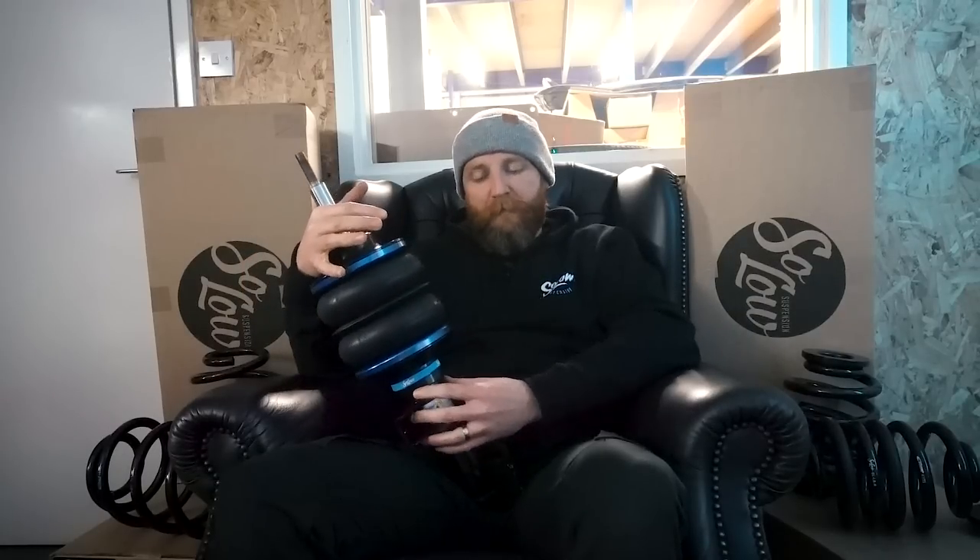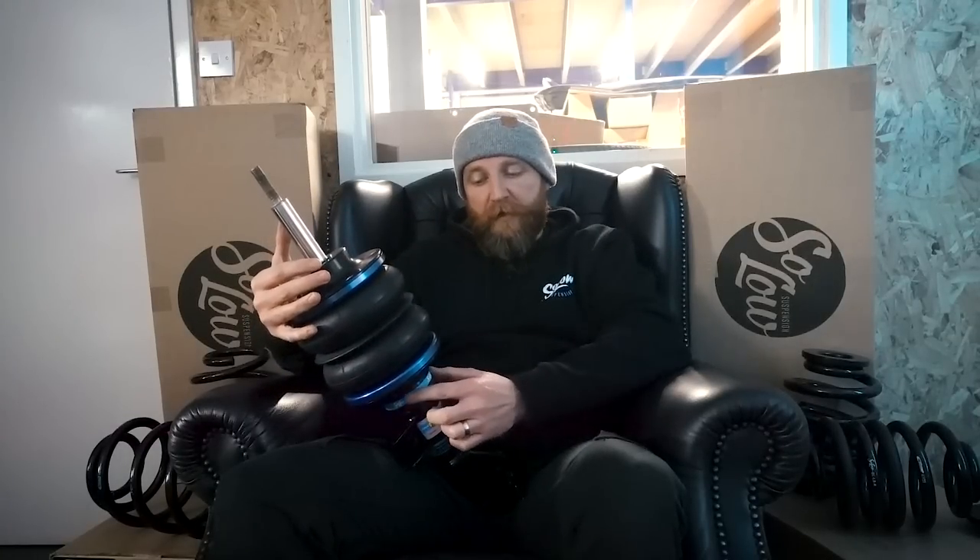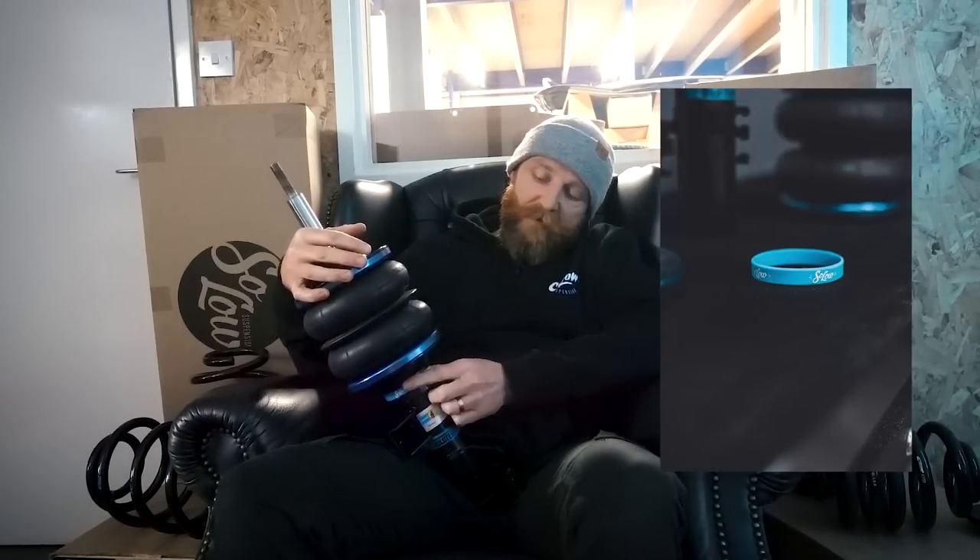With the smaller bag, the squash is a lot smaller, which means we gain more room for wheel clearance — a must in the design since most van owners are trying to keep as highly dished a tyre as possible. It also needed to look good: Solo uses a vivid blue colour theme, so the whole setup is either black anodized or anodized blue to match. We've also gone for black braided lines on the struts — nylon lines would perish, crack, or kink over time, and silver braided lines stand out in a black wheel arch.